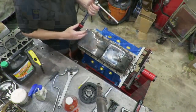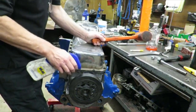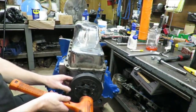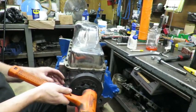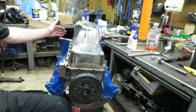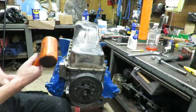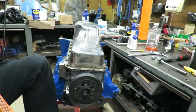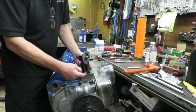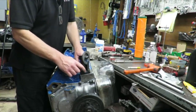That's really all there is to it for the oil pan. Now spray a little WD-40 back on that keyway and hub, then very gently tap the balancer on. One of the problems with beating on a balancer is you're beating against the thrust bearing in the motor. I've seen guys beat the heck out of press-on balancers — that is the worst possible thing you can do. Get your bolts in, make sure you put your gasket on with no sealer, and torque to specifications.